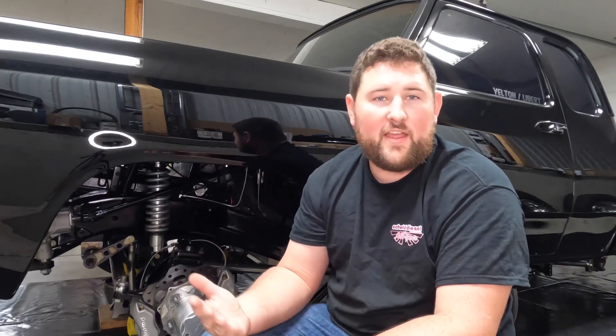What's up guys? Welcome back tonight for another informational video about four-wheel drive drag racing. Tonight we're going to continue talking about the front axle and a little thing called scrub radius. This is the time of year when guys are gearing up to buy wheels and tires, and this is something you really need to factor in when considering the offset, the backspace, and what size wheel to order. You really want to figure in the scrub radius so let's take a few minutes to explain exactly how to measure for scrub radius and why it's important.